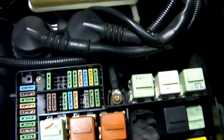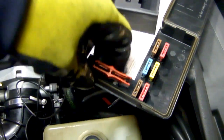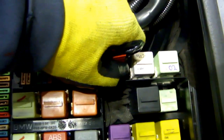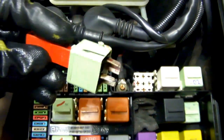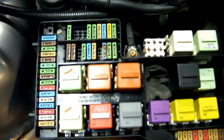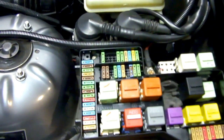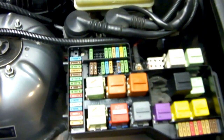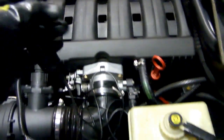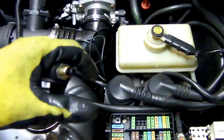What we want to do is grab this little nifty puller and remove the fuel pump relay — pull straight up. Next, start the car, let it run until it dies, and then continue cranking for at least five seconds to relieve the fuel pressure. I have a push-button starter with me, so I'll fire it up, let it die, then keep cranking.